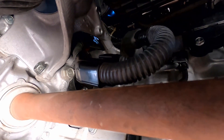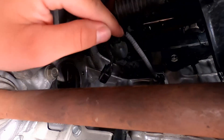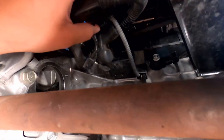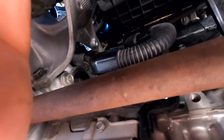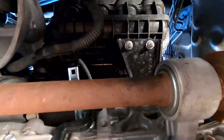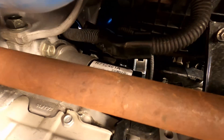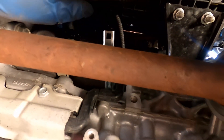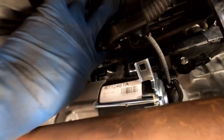I'm going to feed the new starter in — just reverse my steps. I didn't really make this like my regular videos because of the camera quality issues. So I fitted the new starter back in. To show you: this connector bracket, all you do is push up on this little tab and it pulls off. It's kind of hard to show you because it's tight in here, but you can see here's your plug.